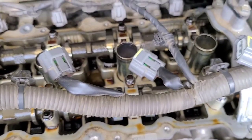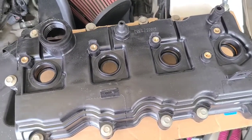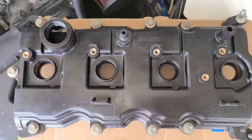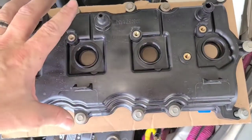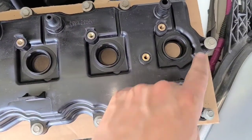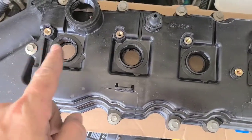Meantime, when you're taking the valve cover off, you don't necessarily have to do this if you're replacing the whole valve cover. I mean, you can if you want. If you're gonna use the same valve cover, start by loosening. This is exactly how it sits on the car. Looking at it from the front of the car, you start by loosening that bolt, then that one,